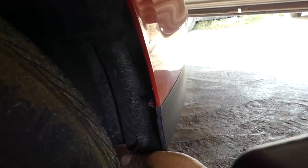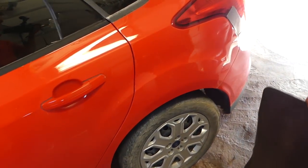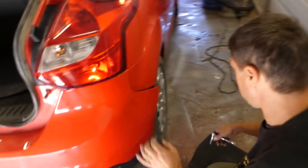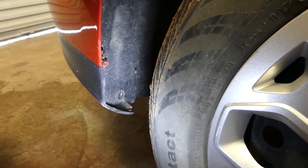Go towards the bottom side of the bumper right there. There is actually a bolt with a T30 that we need to remove. That's what it looks like — you can see it towards the back of the car. We have one on the other side which is identical, so we need to go to the passenger side and remove the same screw there as well.